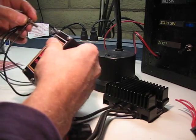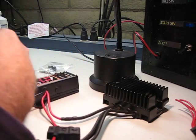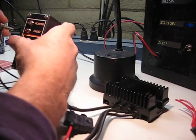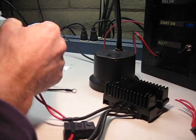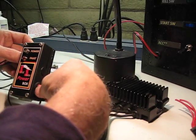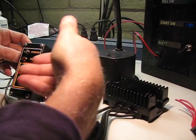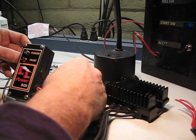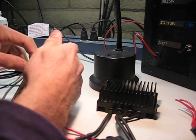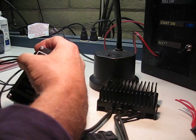It doesn't matter really where it goes because the wire is a fixed length, and that's really the only thing that's kind of critical here. But with this 14 gauge wire, there's no reason to really make it any shorter. It's a short enough length. It's inconsequential, and having that amount of length makes it a little more convenient to find your common mounting point. Now the other wire that will come to this is usually the black-white from the harness.